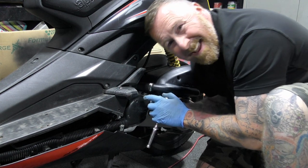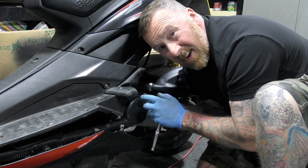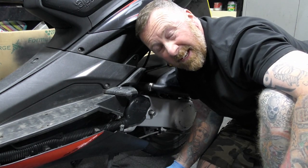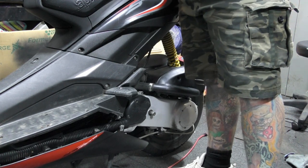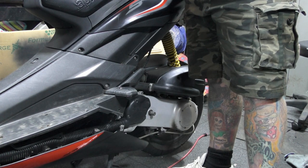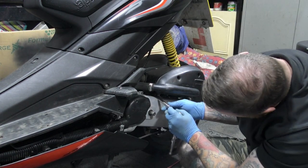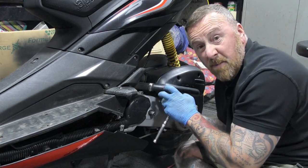So what am I doing? It's all off again. What's wrong with it? And this is why I say you've got to do things again and again and again. There's a rattle. Could be the Bendix, could be the kickstart mechanism. Let's have a listen. It's not right. So it all has to come off.